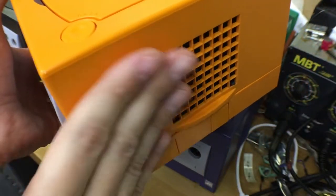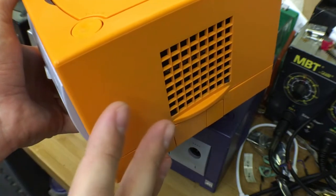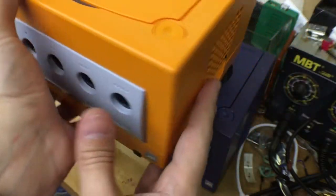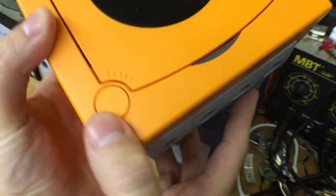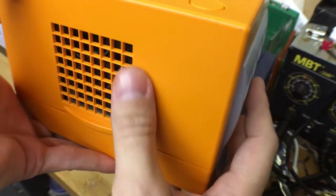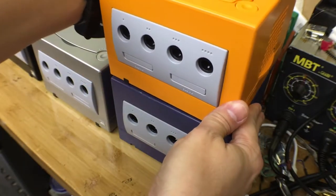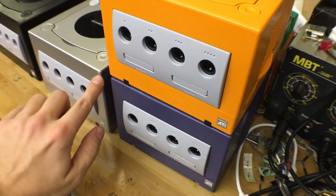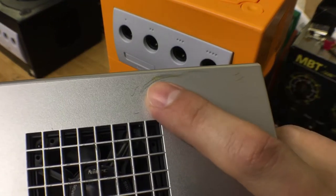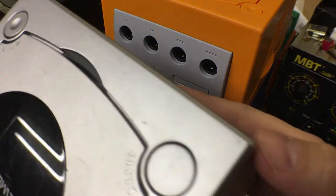And even if you rub it with something that's maybe a little bit more aggressive and abrasive, you just reveal yet more plastic underneath it, fresh virgin plastic. And so some of these just do well. And then the deepest scratches aren't as obvious on these lighter colors, again, because underneath it is more of the same color. Versus this one here, the silver one, as you see in some of the gouges that it has, it's revealed its true color of the plastic and not this sexy, sparkly stuff.